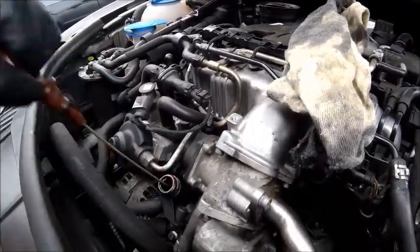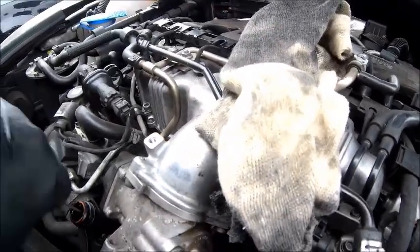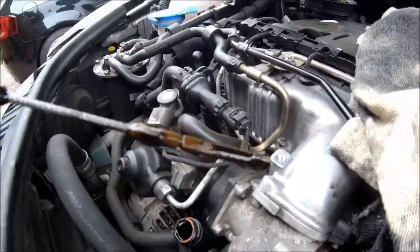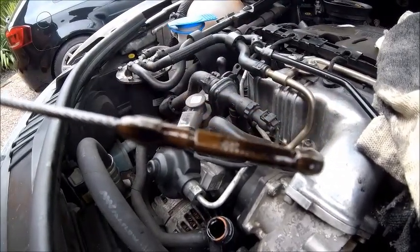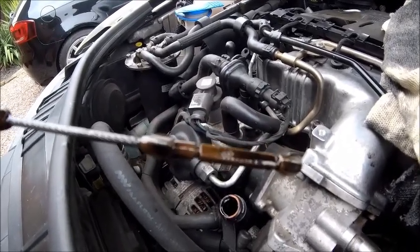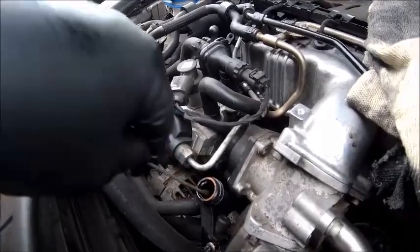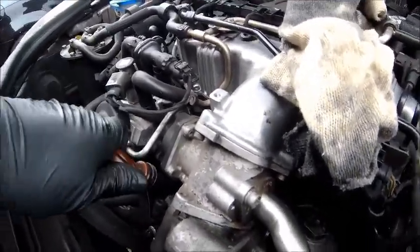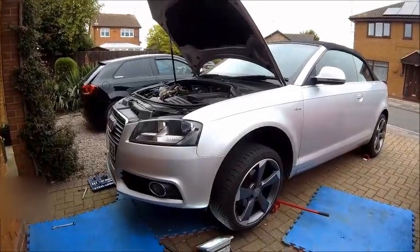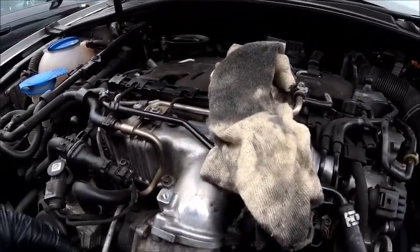Quickly start it up and see where we are — don't forget the cap by the way. I've left it for a couple of minutes so pulling the dipstick now, give it a quick wipe, slam it back in again, back out, and the level says three-quarters. That will do for me. I'll check it again in a couple of days and just top it up if necessary. Take it to the top limit or just slightly over, start it up, let it run for a minute, then let it stand and check it. Yes, it's jacked up and you shouldn't really check the oil when it's jacked up, but the driveway slopes down so it's fairly level.